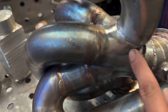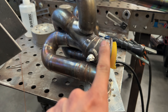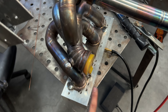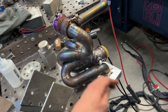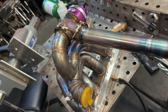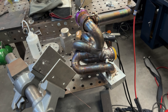All right — I got it cleaned up. You can kind of see the crack better. I've got two holes drilled at the end to stop the crack from spreading. I've got it back-purging right now on the block. After that, the next thing I'm going to try to do is brace it somehow — maybe one from here to there, one from here to there, and maybe even one here — just so if it moves, it doesn't move that much.